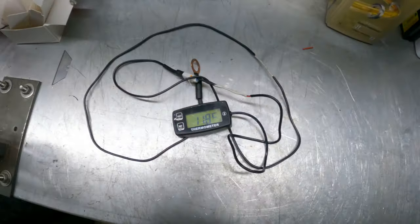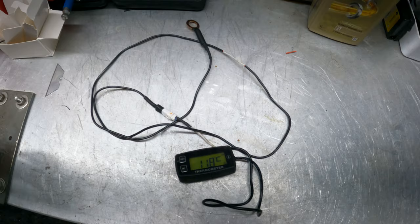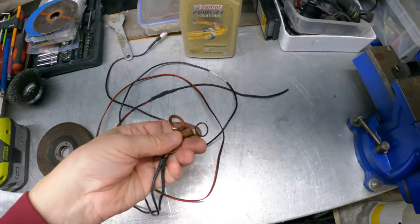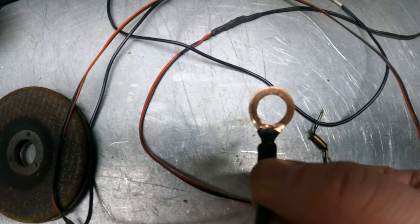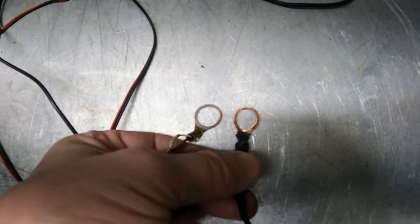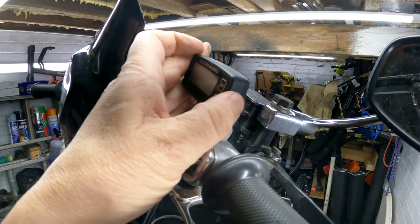Good news — I've extended the wire and soldered all the joints, and it all works now. All that remains is to fettle the sensor so it fits around the spark plug and run the cable. The new wire is longer which is great, however the new one has a whopping great big spark plug sensor whereas the old one has a really thin one, so I'm going to have to modify it to match the original. The sensor fits — it's just a case of running the wire under the leg shields and up to the headset.